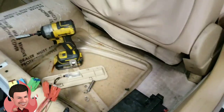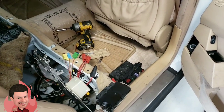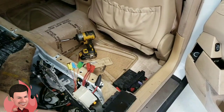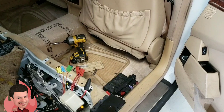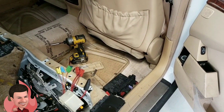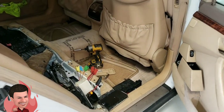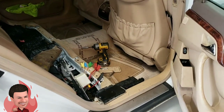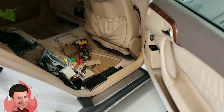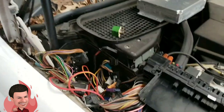The SAM is mounted flush with the floor. I've already lifted the carpet and felt underneath, and there's definitely water under there — it's still wet. To do it properly we have to remove all the seats and get the carpets out to dry at a minimum. This water has likely been sitting for a while. Ideally the carpets should be replaced, but that's the client's choice — we can dry them and apply anti-mold spray, but if water has been there for a month or more, I'd recommend replacing them. This is where we're at, and we're sending this video to the client to see where he wants to go from here.